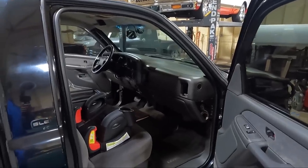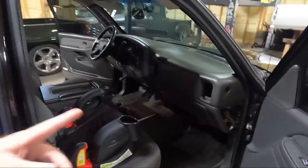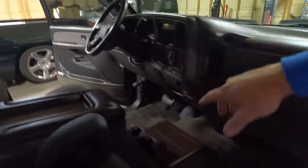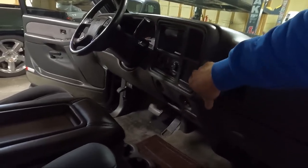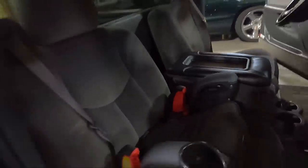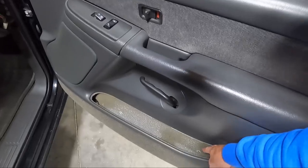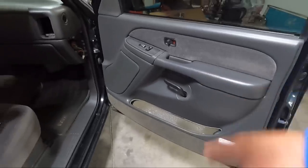It's not really hard to pull - you've got Phillips screws on both sides at the ends, a Phillips behind each vent, two little white tabs on either side, and then it's 7mm once you take the radio bezel off. When you pull the vents up you pull them just a little bit to clear and then straight out because there's little clips - every one of those was broken on the old one. I also got a pocket piece for the dash and a closeout panel. Looked like somebody had been spitting chew in the back pocket.